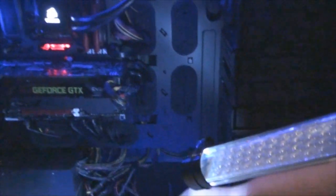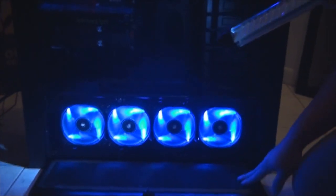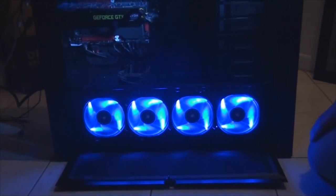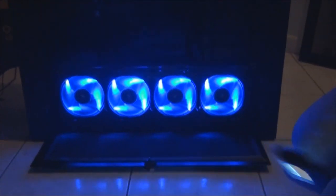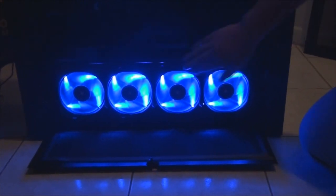One final note with the case — because we built it with great airflow in mind, we really wanted it not to overheat. And Bruce's favorite color is blue, so we went with that. We built the sucker with 14 different fans total. You can land an airplane up here. We also have fans mounted right under the radiator of the cooler, set up in a push-pull configuration. These two fans are pushing air up into the radiator, and we have two more fans on top pulling air through, so we're getting maximum efficiency from the radiator.